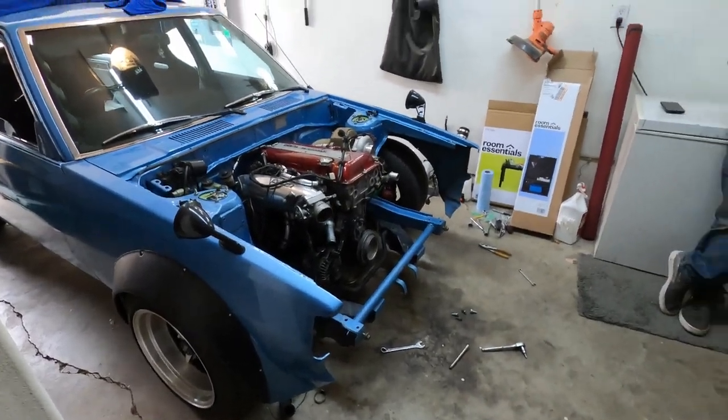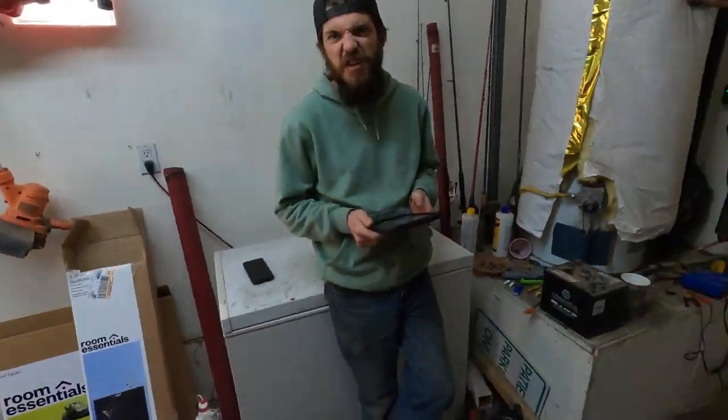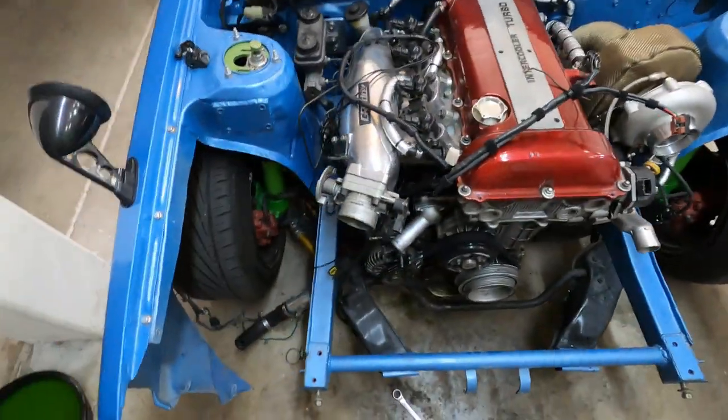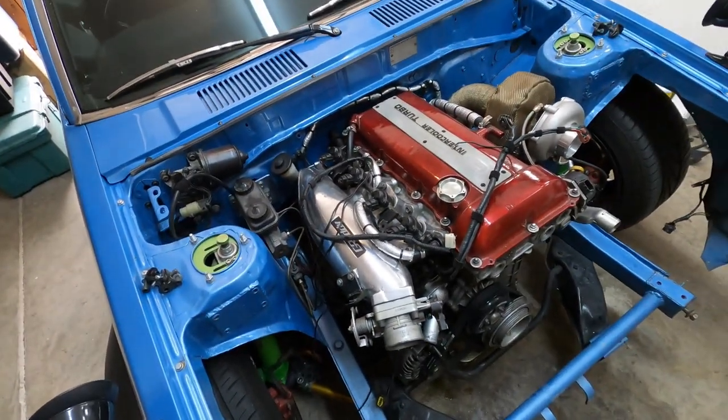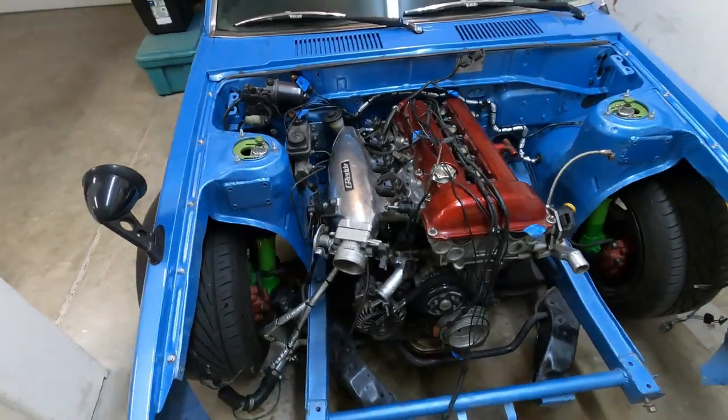That's how you remove the front clip off an '83 Corolla wagon. It didn't come from the factory like that, but it's just a couple bolts and it works out great. Anyone doing this — don't weld them in, just bolt them in, so much easier, even if you just do it with the rad support. From here, continue removing turbo, exhaust manifold, the rest of the wiring, fuel lines, clutch, driveshaft, trans bolts, trans mount bolts, engine bolts, and disconnect the heater core — that's it.